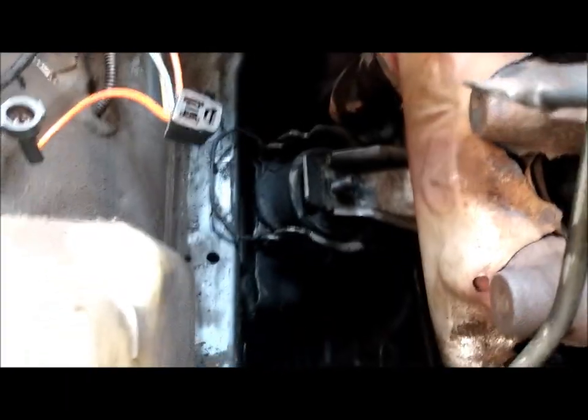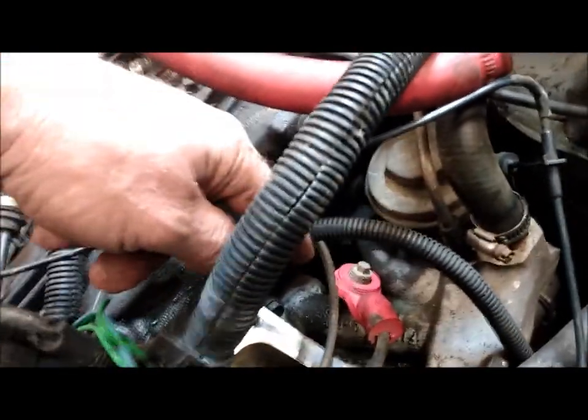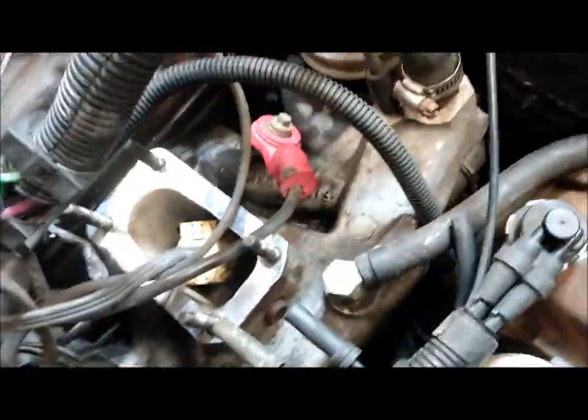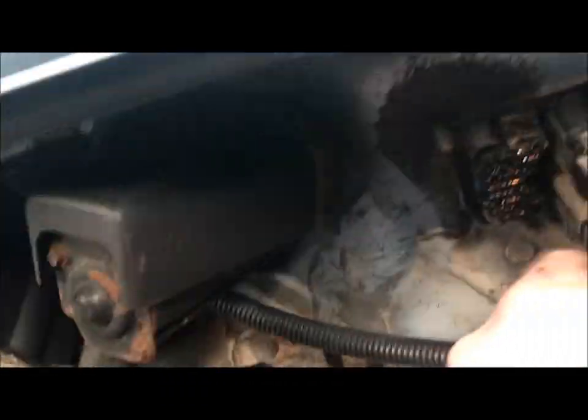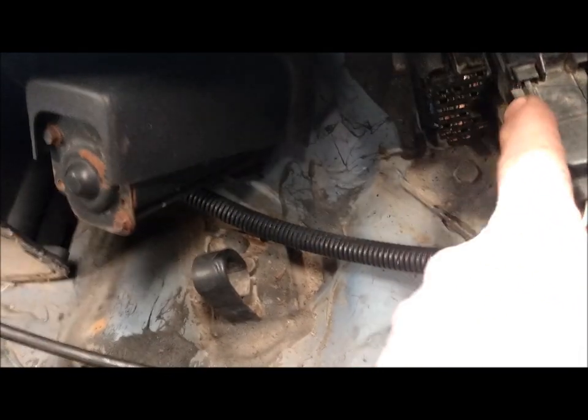Remove your cable to the carburetor for the throttle. Take your carburetor off — it just makes it easier and nothing gets damaged. Move your vacuum lines off the carb. What I do is take the connector right off the firewall — there's a quarter-inch bolt and a couple of little tabs.